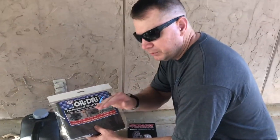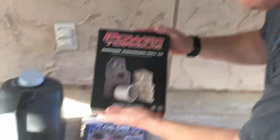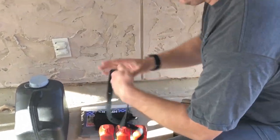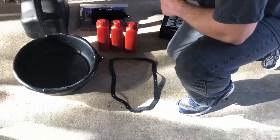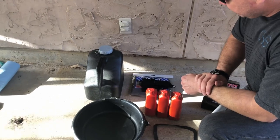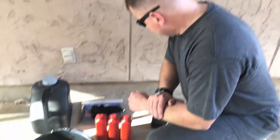I'll have an oil catch on the ground as an extra precaution to keep fluid off the driveway. I have some cat litter in the back in case I spill, to make sure I don't contaminate any water around here. Next is the transmission kit I purchased — it comes with a basic filter and a rubber gasket. Here's the filter, looks like it'll have two bolts holding it up, and here's the rubber gasket which gives you an idea of how small the pan is. I also have a large catch jug with a big three-inch opening so I can pour without spilling, and I'll take the old fluid to the parts shop to recycle it properly.